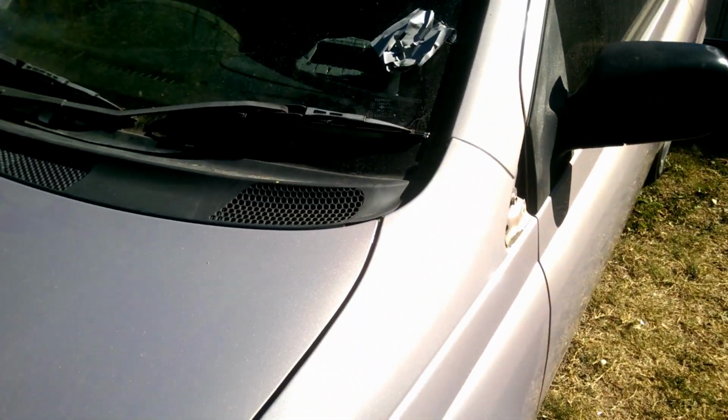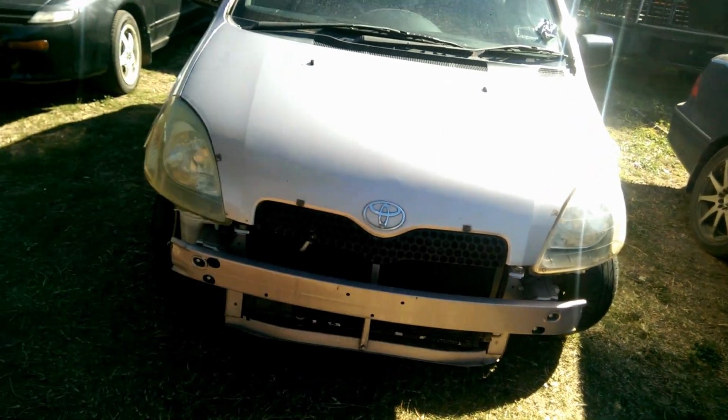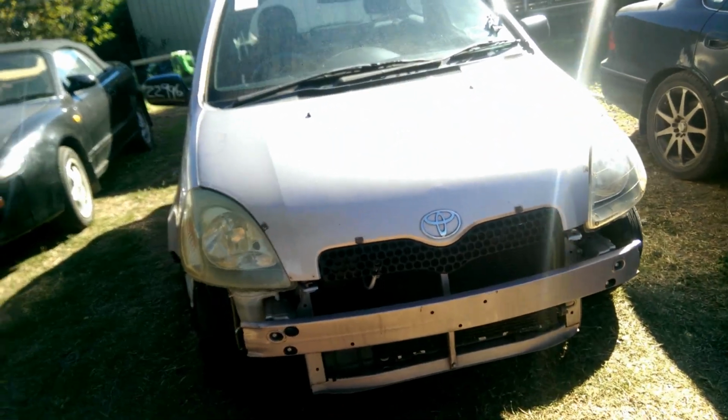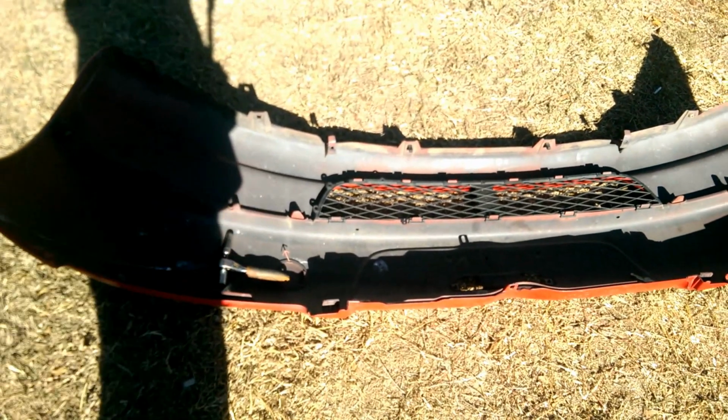This one, I don't know. I mean, this one still needs a bit of adjusting. It's out there, so I don't know. Once that comes in, that rear gap closes up. So yeah, I just got to play around with it. Just adjust the bonnet a bit, and get it back in line. But the headlight now is in good line. Memory, actually, this one's out a little bit. So yeah, I just got to play around with the bonnet a little bit. As for the bar, well, I'm going to separate that and start sanding on that top section.